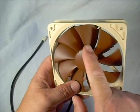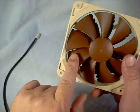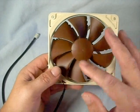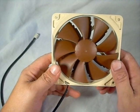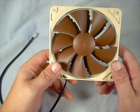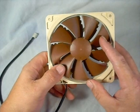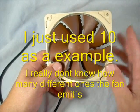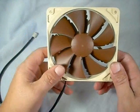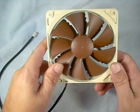If you can see the close-up of the vortex notches — for people that haven't watched our previous Noctua fan videos, I'll explain what these vortex notches do. Basically, if the fan blades don't have them, they emit one frequency of sound that tends to be loud and annoying. By staggering these notches on the fan, they break up that sound wave into different frequencies so that any one of them is less noticeable. Instead of one really loud frequency, you may have ten frequencies all at a lesser decibel so you won't even notice it running. That's Noctua's design to move as much air as possible while doing it as quietly as possible.